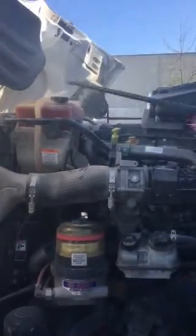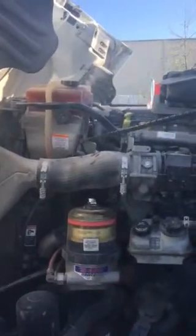Going on to my driver's side. Here I have my coolant reservoir. My reservoir is not cracked or broken, tight and secure with its full set of nuts and bolts. Checking for any leaks under my reservoir, making sure the fluid is also at its proper level. Both caps are on tight and secure, not cracked, broken, or missing. The hoses coming out of my reservoir have no cuts, cracks, or bulges; secured at each end, and I'm checking for any leaks.